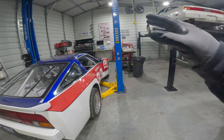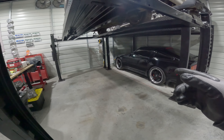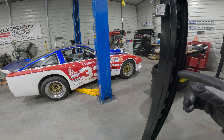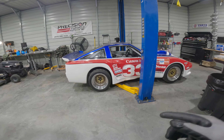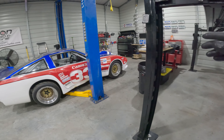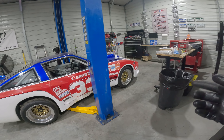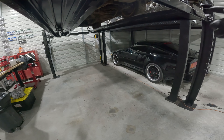Comparing the two cars: the '89 has the CTS-V second-gen setup — six-pot Brembos up front and four-pot Brembos in the rear. The wide body has the CTS-V first-gen — a big four-pot caliper setup up front and R34 GTR two-pot Brembos in the rear. Both are well-balanced setups, but I don't like how the wide body's brakes feel. You might wonder why I didn't go with six-pots from the start — there was a thought process behind that.